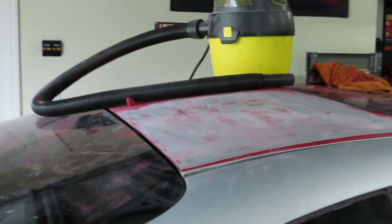And then on this side, we still have to go, using a little vacuum to catch all the debris in the meanwhile. After we get it done being sanded with the 80 grit, we're gonna go up to a 400 grit, or probably do a 180 in between if it's too aggressive, the 80 to 400. But we wanna get that nice and smooth like the rest of the car, that way it can be painted good.